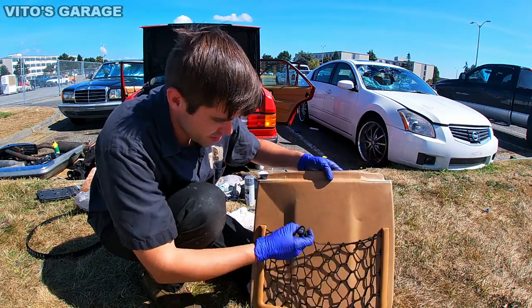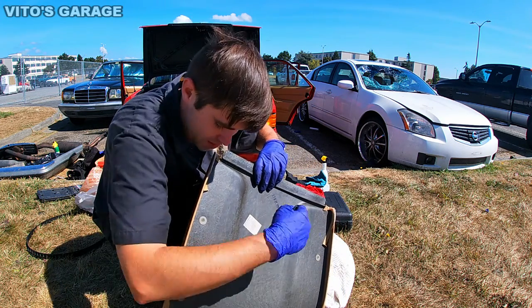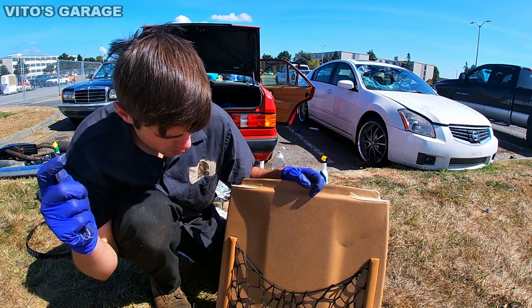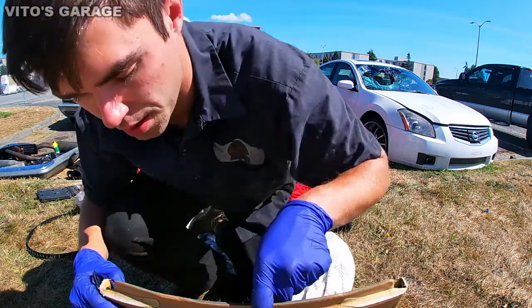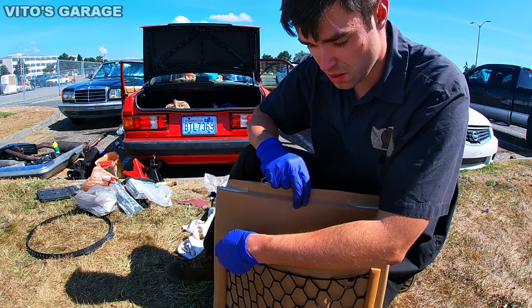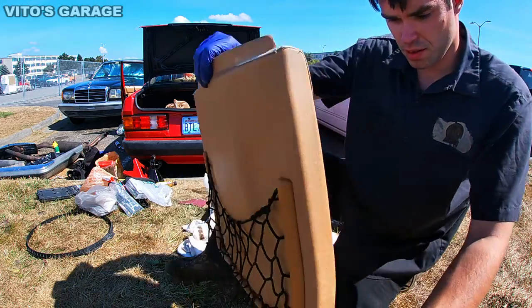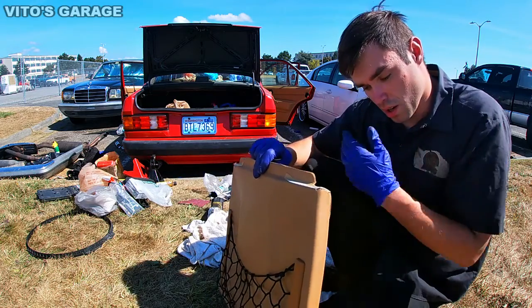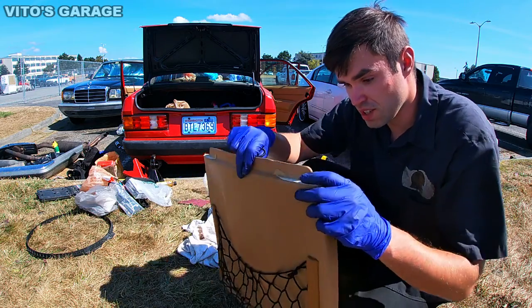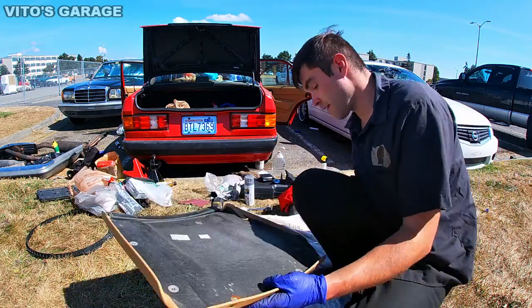Here's our net — it's all saggy and ugly. On the back side you have six Phillips screws that you need to remove for this to separate. Keep in mind that on some other Mercedes chassis there are no screws — some have clips — so consult your factory service manual or find resources online for your particular car. On the W201 190E, it's simple and you won't break anything, since you just remove six screws and the assembly comes off.